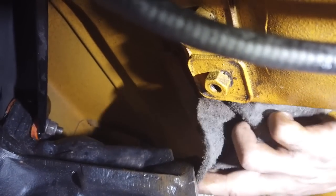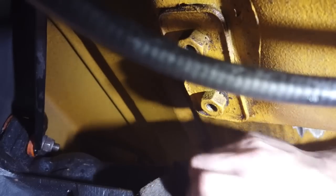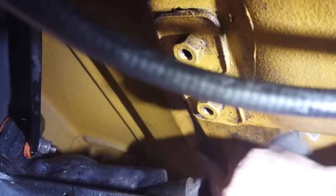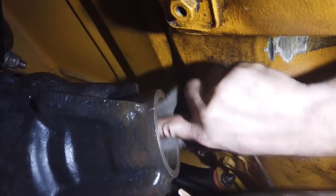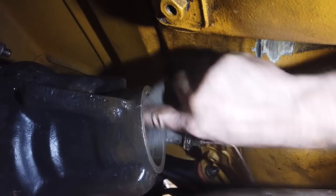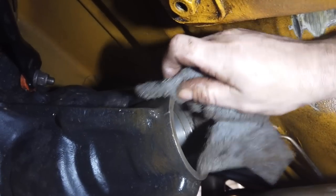This assumes that the crush washer, when we reassemble it, we can torque that pinion bolt back up without continually collapsing the crush washer. We have taken a picture and counted the threads to try and re-emulate putting on the pinion bolt. Again, it's all approximation. We don't expect this to achieve results, but you never know. Sometimes you can get lucky, and just pure bit of luck, you can end up putting it back together and you actually think, wow, it's pretty quiet, we'll live with it. You just don't know. But one thing is for sure, nothing can be as noisy as what we just experienced. The alternative, of course, was to just simply put Ruby's axle straight back on and walk away saying, well, that was a waste of time.